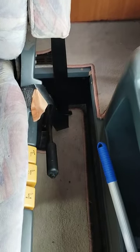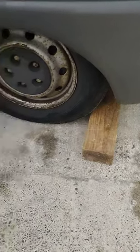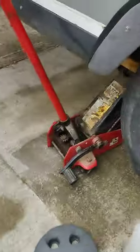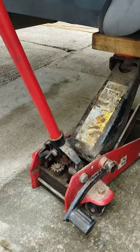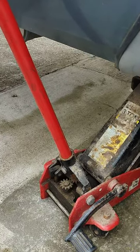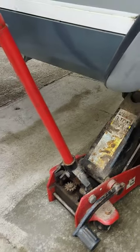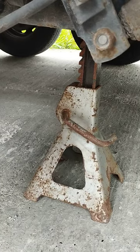I've come into my van and my handbrake is fully applied. Your next job is to put a chock under the front wheel — your safety is the most important thing. Obviously jack up the camper van, but never guarantee that a jack is a hundred percent safe. There's always a chance that a seal could break, and if that seal breaks and you're under your camper van, you're in trouble. So as a second measure, always use a good jack stand.